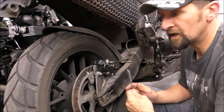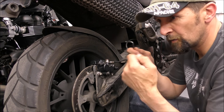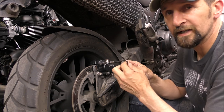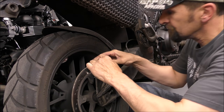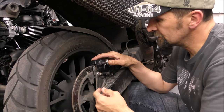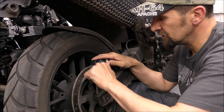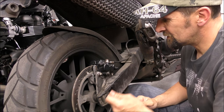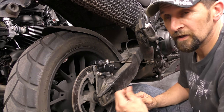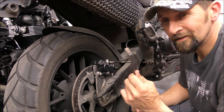Option one is to take some JB Weld. Now, we all know JB Weld, fantastic stuff. It's a two-part mix-up, gluing, metal bonding stuff. You just mix it up, put a bit in the end, squidge that in there nice and hard, and give it the requisite time that it needs to set and cure, and then you should be able to undo it, hopefully. But I've got JB Weld, and I have tried it once, and it didn't work. So what I'm going to do, I'm going to weld it.